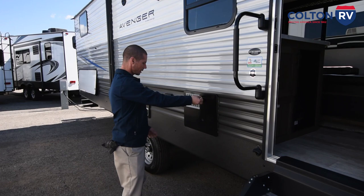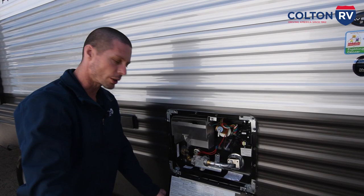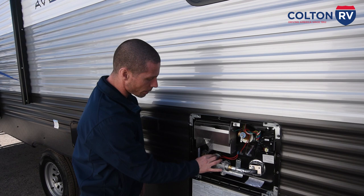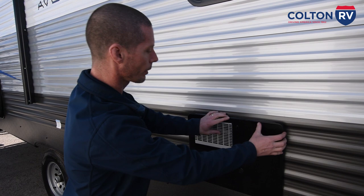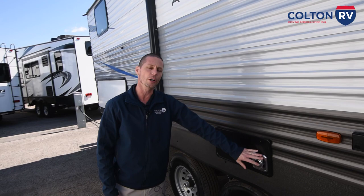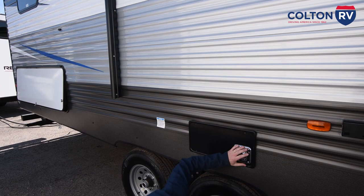Then you have your hot water tank right here. This is the drain plug for the hot water tank. Right now it is winterized, so there's no water in the system. Whenever you go to de-winterize, you want to flush all the water out of the system, un-bypass the hot water tank, and then put the drain plug back in. You are going to light it from the inside. There's also a 110 outlet for outside under the awning. This exterior part of your furnace — when this is running it does get extremely hot, so be careful you don't burn yourself if you lean up against it.